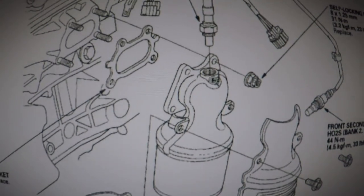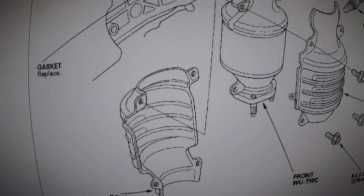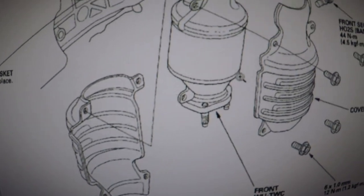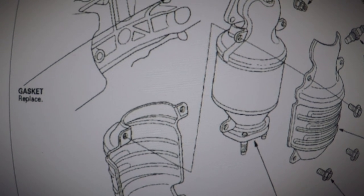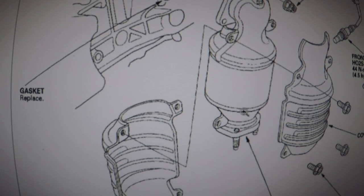These oxygen sensors, I'm gonna let this one drop with it. I'm gonna just disconnect the connector. The one in the bottom, I'm gonna see how the bottom setup is. The bottom one goes over here to the side. And if it has the same, it can come down with it nicely and smoothly. I'm gonna just let it drop right with it, all right? And that's how simple it should be.